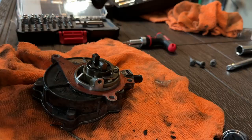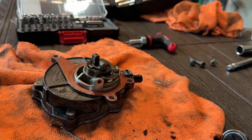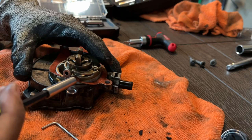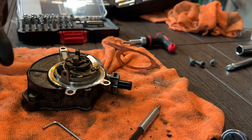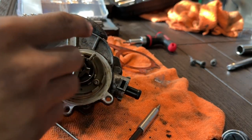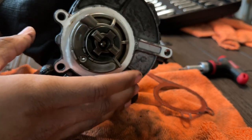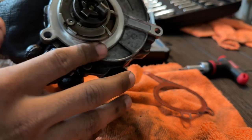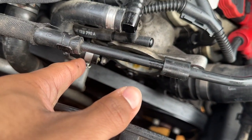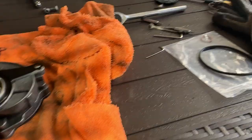When you do this with the correct kit, take this seal off at the back and replace it, then clean everything down and wipe down the back plate as well. I'm going to take off this gasket and replace it with the new one — pry this off. This is for the 3-liter V6 — it contains the gasket, while other vacuum pumps like the 2-liter or 3.2-liter contain a smaller O-ring seal instead. I'm going to wipe down this area first because gunk can cause an improper seal. Once cleaned, I'll lay the new gasket on top and clean off the mating surface.